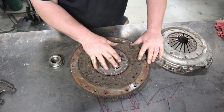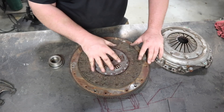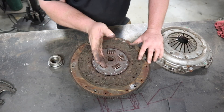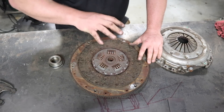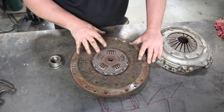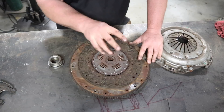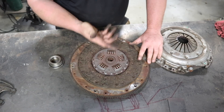These little springs right here are for when your engine is running. Say you have an eight-cylinder, four-cylinder, or six-cylinder — every time a spark plug fires, the engine's going to jerk just a touch. On a diesel engine it's really, really bad because it goes pow-pow — it's kind of more violent. So these little springs, when you go to let the clutch out, take up a lot of the vibration and energy from that engine vibrating as it turns.